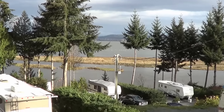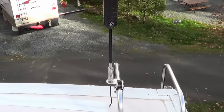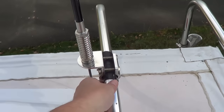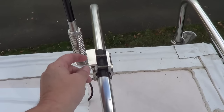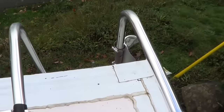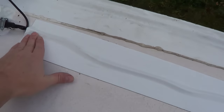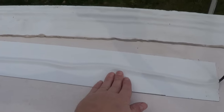We're up on the roof and I've attached the WeBoost RV trucker antenna to my ladder rail using the provided clamp. It doesn't need a ground plane — it has a built-in ground plane, so it just needs to be attached to some rail. I put some rubberized tape underneath to stop any rust from dissimilar metals, which worked really well with my flagpole mount. I ran the antenna wire across the top of the roof and used some Eternabond tape to keep the wire in place, the same way I did with my solar panel wiring — so no extra holes in the roof needed.